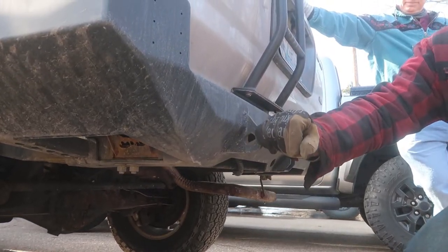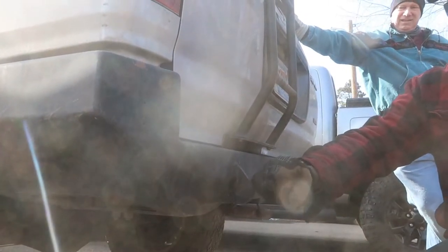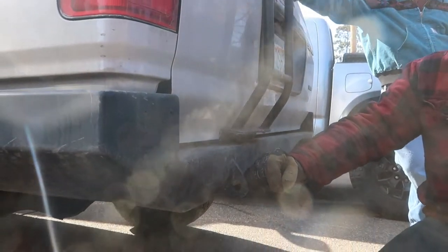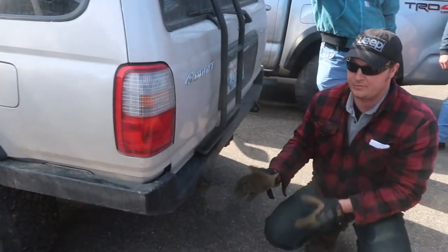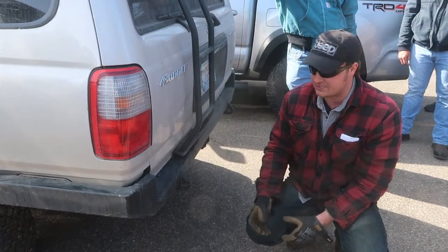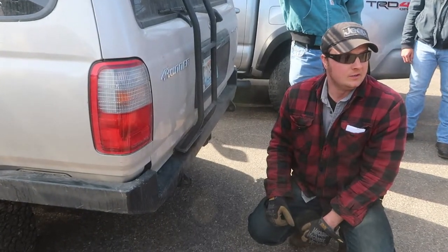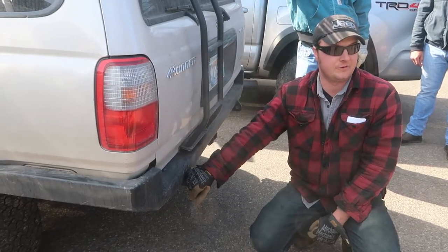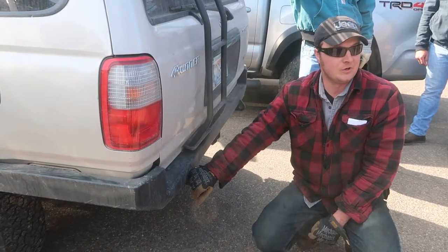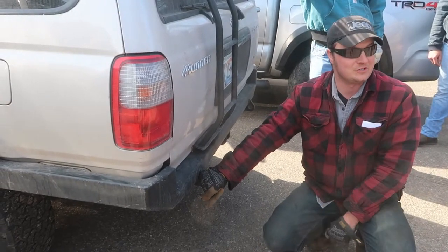So this one you could pull sideways if you had to, but anytime you're pulling anything and you're stressing it already, say this thing's really buried, you want to winch if possible and not pull with a strap, because that strap has so much inertia when it does go. Whereas if you're just doing a slow pull, stuff usually starts to creak and make really funny noises before it breaks. Whereas when you jerk with a strap, you don't know it till the strap's flying through the windshield.